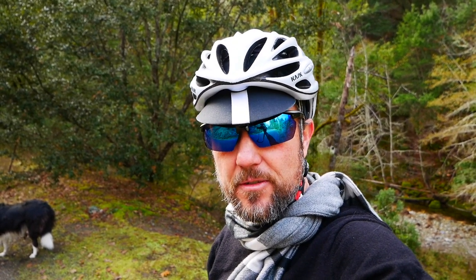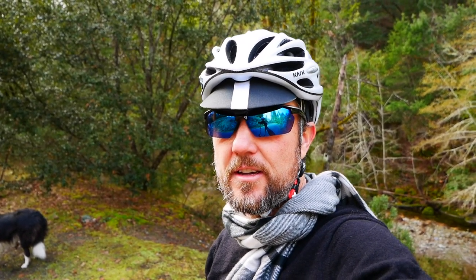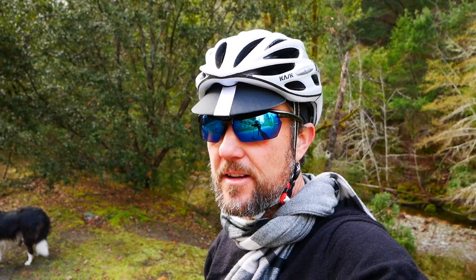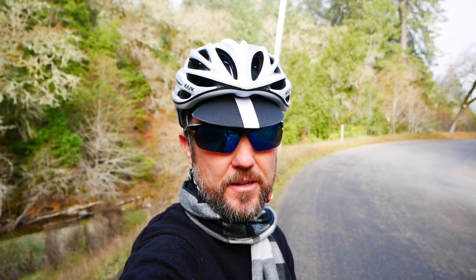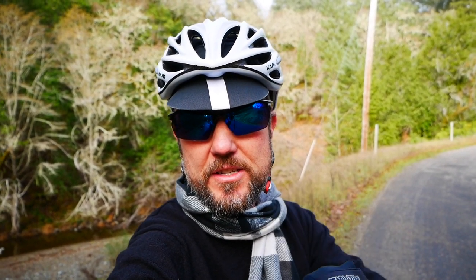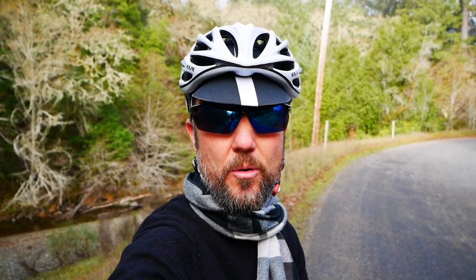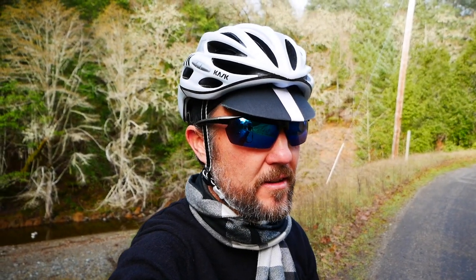And I do about 10% gravel rides with this bike, so it does see gravel. I see dirt roads. I ride it in mud. Yesterday I was riding it through a muddy section of the road, and I have fenders, so there's always a chance for a puncture flat when you have fenders, because little debris will get stuck between the tire as it's rotating, and then the fender will kind of force it to lodge into the tire. So you have that risk also. With all those risks, to report one flat tire in 3,000 miles, that's fair.